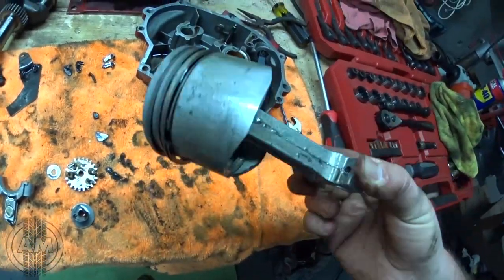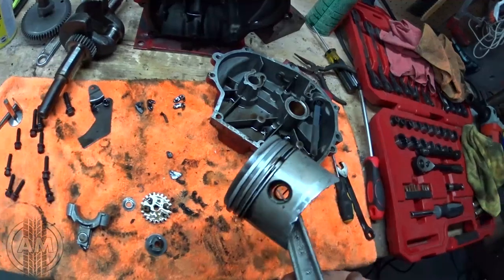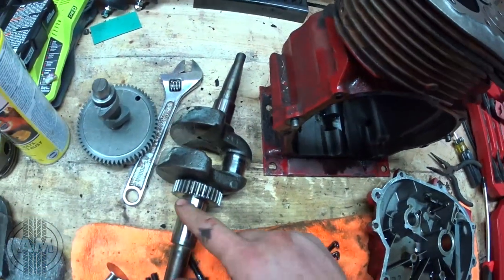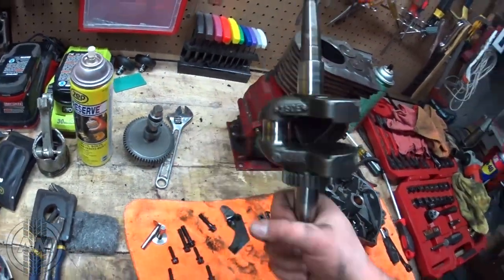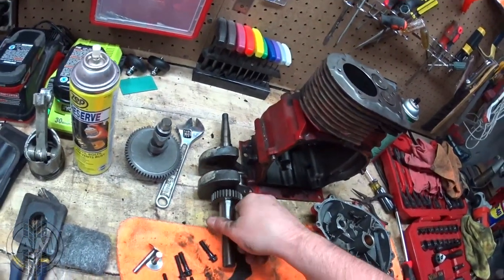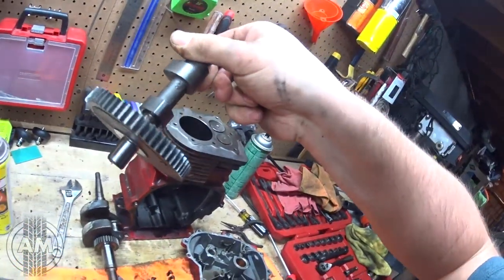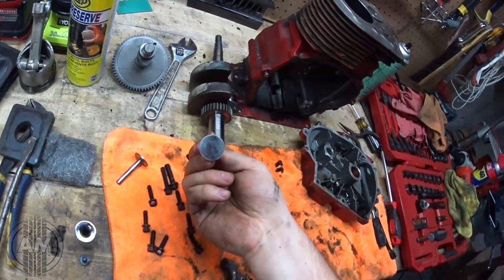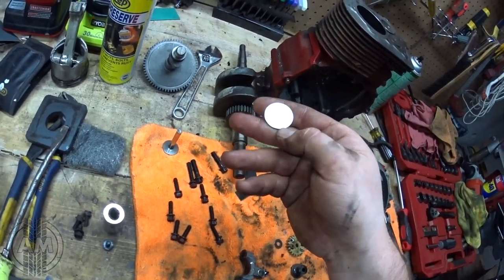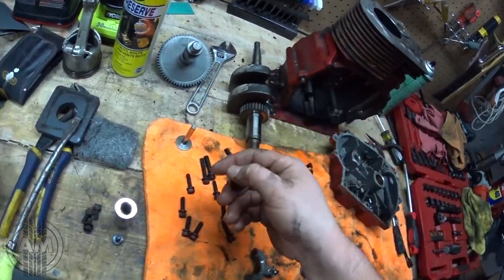It went wrong and it went wrong in a big way. Luckily the cylinder itself isn't scored, so the block itself is saveable. The actual crank isn't in too bad a shape — I would consider reusing this crank. The cam looks like it's brand new practically — no heat scorch marks or anything, cam's in good shape. And these are the lifters — one of them's got a little bit of excessive wear with a dimple in it, so this one should be replaced.